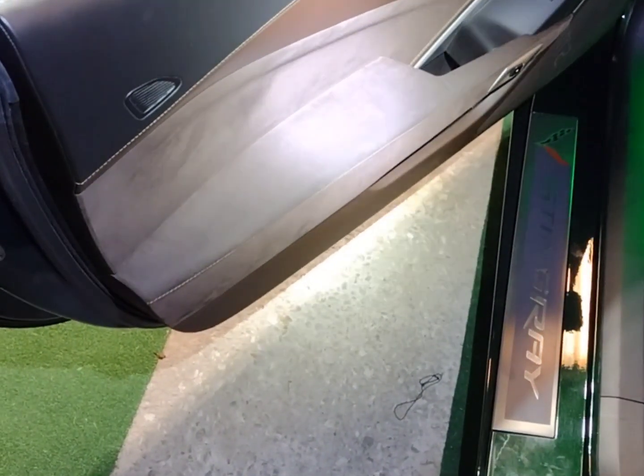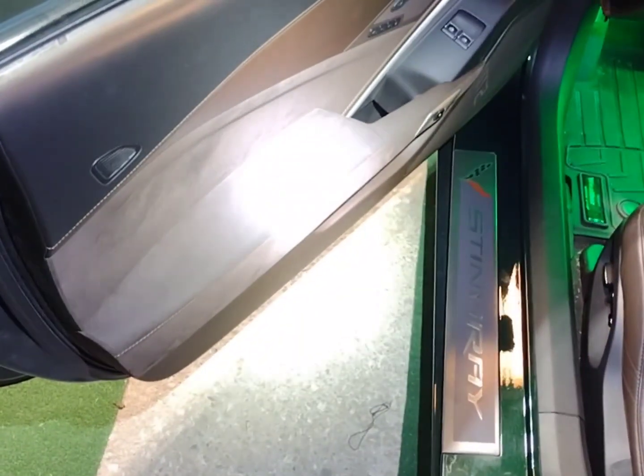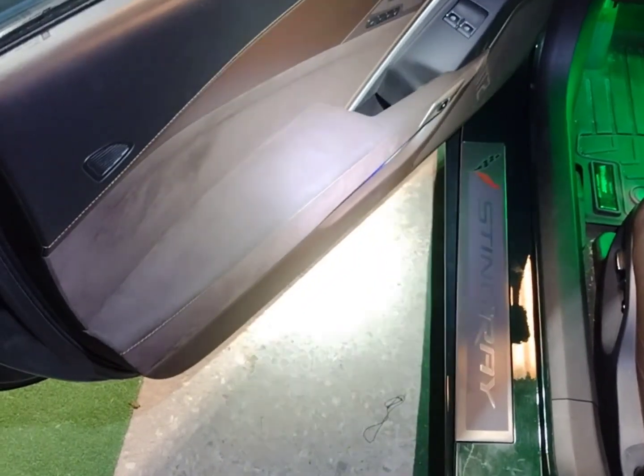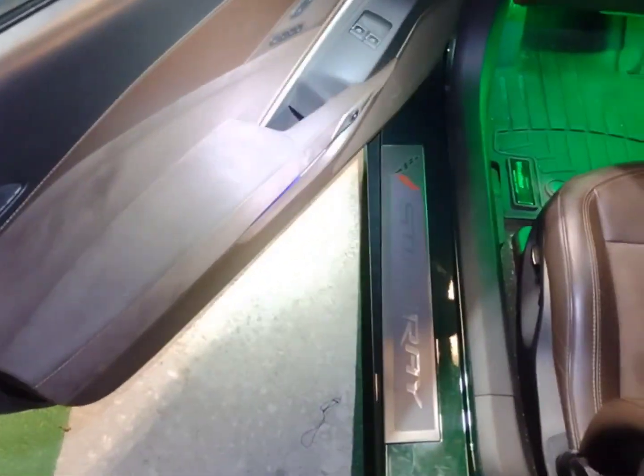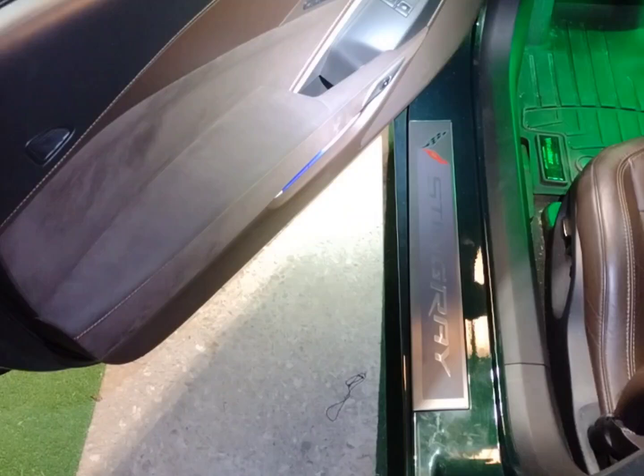So basically, what you're going to do, in a nutshell, is with your ALCANTARA Suede, you'll moisten the Suede, you'll apply the Sonax, you'll brush it in with a very soft brush between 5 and 10 minutes, making sure you brush out any loose dirt and contaminants before you start anything. After you let it sit 5 or 10 minutes, then you wipe it down with a wet microfiber and repeat as necessary.